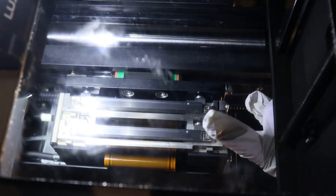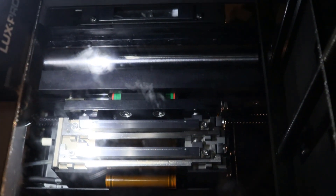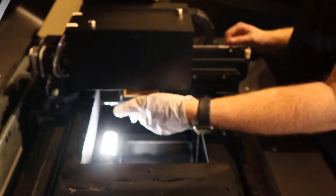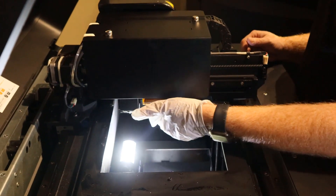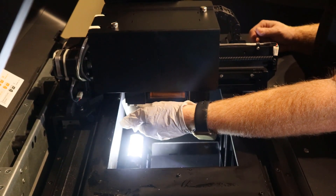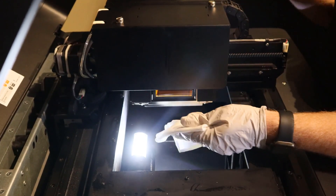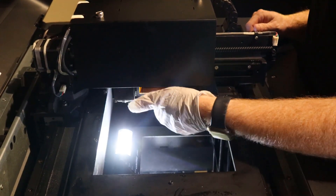Just to show you what we're working with underneath here — we've got our two heads, and the roller is further back, and we need to clean all of those. Get your cloth and lay it across both of the print heads with a little bit of gentle upward pressure, and just wipe back and forth covering the entire span of the print heads. Make sure you're not catching the corners too much — you don't want to rip off the tops of those heads. Just a couple wipes back and forth will get it.